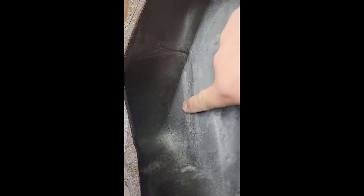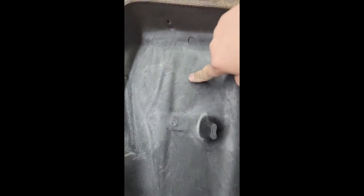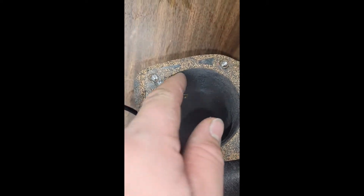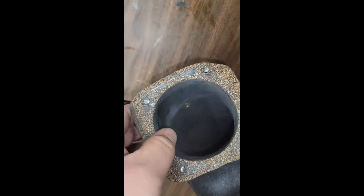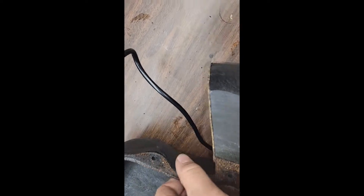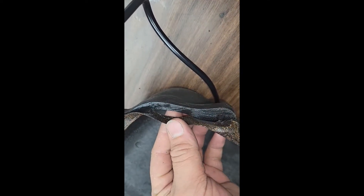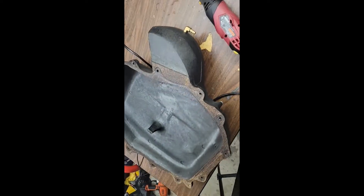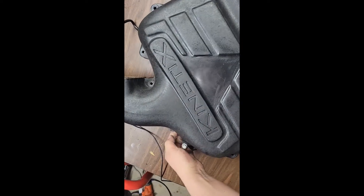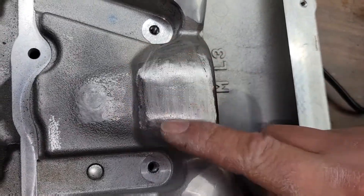Getting this pretty flat — it's a lot better than that lip we had. Here's the throttle body area, which actually came out really good. There's a lot of plastic in there but compared to before, I got the radius all trimmed and that hard line that was there is completely gone. Also, we're going to need a different gasket because this one is already coming off — the adhesive gets messed up by the oil. So that's about it for the top manifold, the Kinetics.